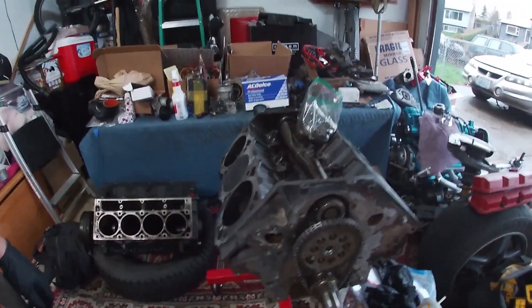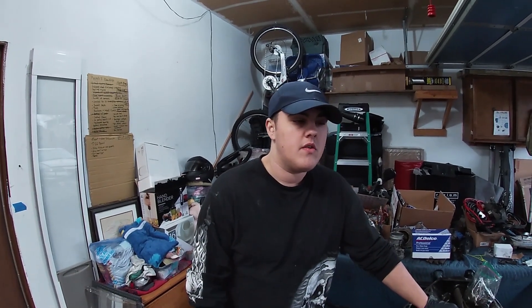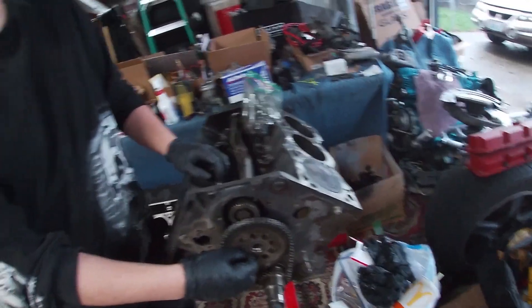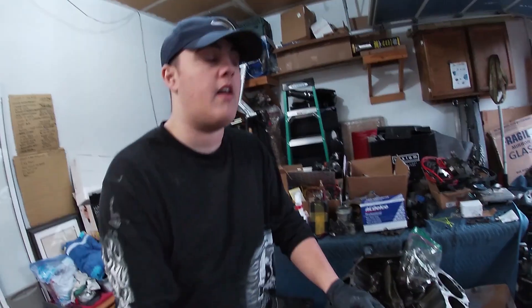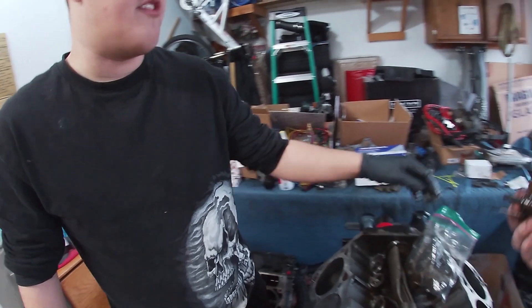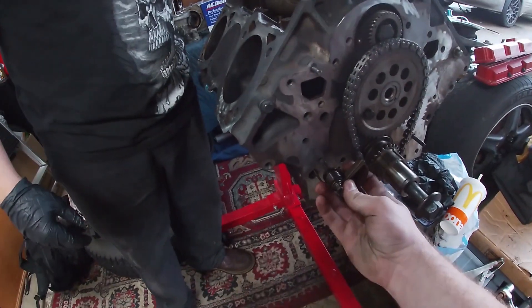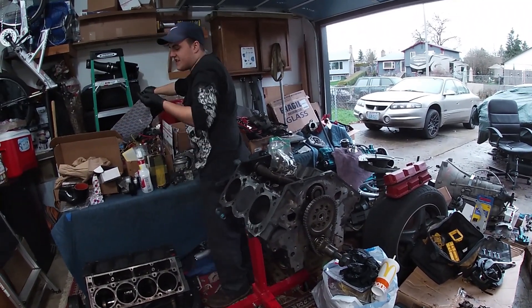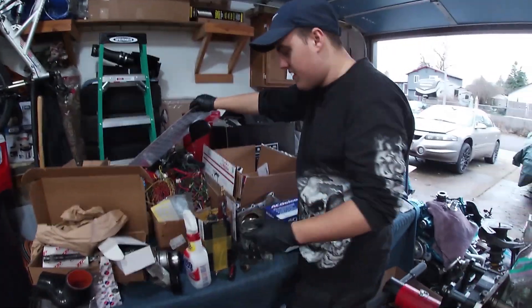Also, the magnet — it's important to have a magnet in here because your cam position sensor reads from it. If you break it, it's expensive — about 40 bucks. We almost forgot to do that on Project F and had to tear it back down to put the magnet back in. We accidentally broke one of the little tabs and ended up epoxying it back together. So definitely don't forget it — the engine will just not fire up without it.